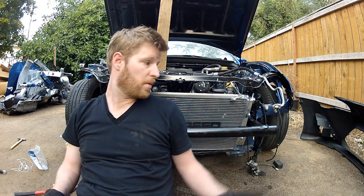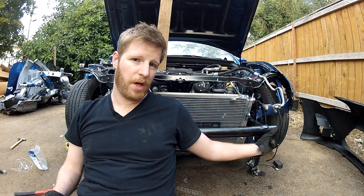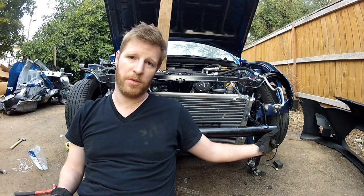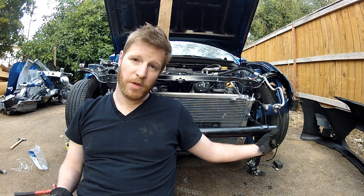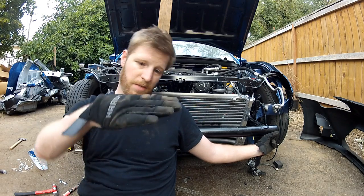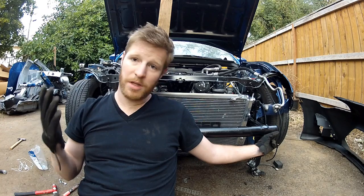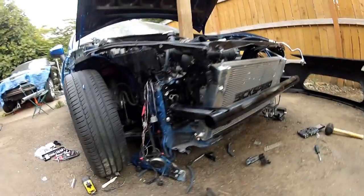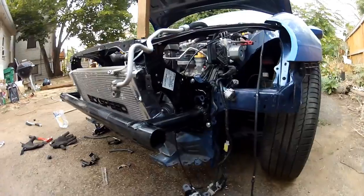Bumper's on — went pretty well. In retrospect though, I said at the beginning this was a DIY and I'd show you how to do this, but don't do this on your own. Definitely go buy the OEM bumper — I looked online and this one was $170 brand new from the factory. Making your own is just too risky in the long run. If any welds aren't solid, or the pipe geometry's off, or you got one weird angle, as soon as you hit anything this thing's just going to go the path of least resistance and be almost useless — or possibly worse than having nothing at all. So jump on eBay, find an OEM one. I'm going to use this because I'm just going to track this car, and as soon as I drift it into a gutter I'll replace it with the OEM one. This was fun to build, it came out great, it holds my weight — about 200 pounds. But if you're doing this at home, definitely just go buy the OEM one and bolt it on. Save yourself a lot of time.